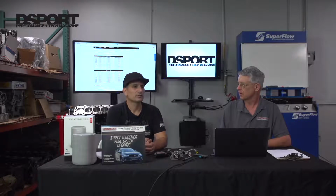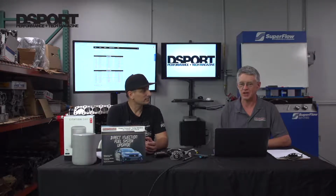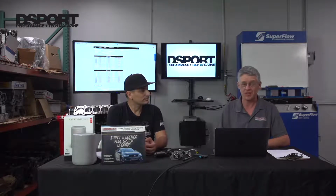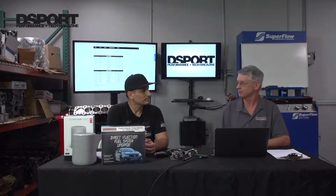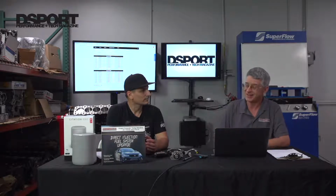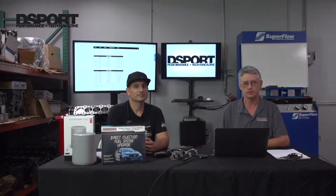Yes. And I've looked at some of Honda's test engines that have done 50, 60, 70, 100,000 miles and observed the back of the intake valves on those engines, and there's no significant carbon buildup. A little bit, of course, as always, but nothing that is going to close or significantly close the intake ports, which I have seen on some other European engines.